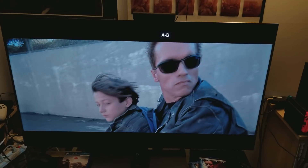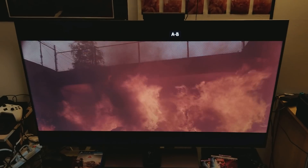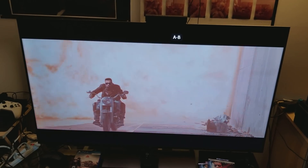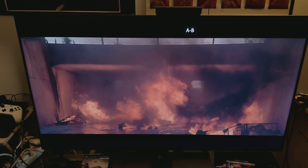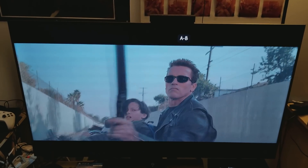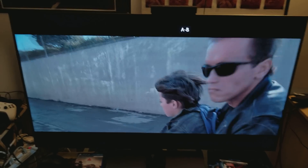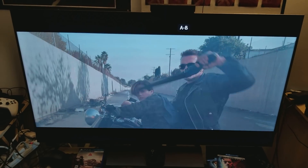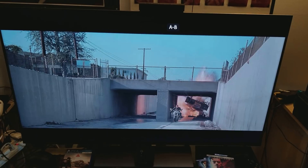Put as many local dimming zones as you can on an LCD LED backlit TV — that's the only way to avoid bleeding light and truly get those deep dark levels. So there you have it: this is the comparison between edge-lit versus FALD — full array of local dimming. As you can see, full array of local dimming wins clearly. It's a clear-cut case — edge-lit loses, full array local dimming is a must-have for an LCD LED TV.